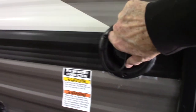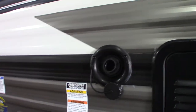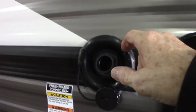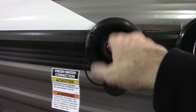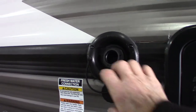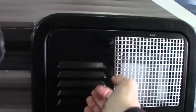This is the fresh water tank fill. The most common way to get water to this trailer is the city water hookup on the other side — I'll show you that when I get over there. But keep in mind, if you go to a state park that has a fill station when you pull in but there's no plumbing on the campsite, you can pre-fill this fresh water tank and use the onboard pump to pump the water. I'll show you the switch when we get inside. So even if you don't have city water, you can take the water with you or fill it along the way and still have all the features.